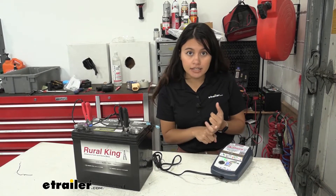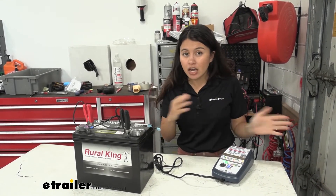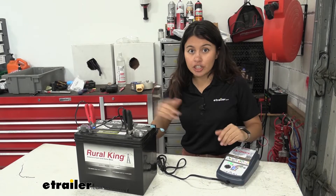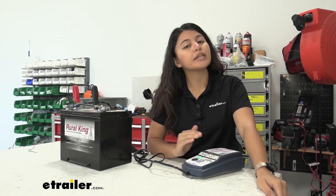During the Save portion there are actually two steps — step four and step five: Turbo Save or Pulse Save. One of the main reasons people get the OptiMate 7 is that feature. Depending on how sulfated, flat, or neglected your battery is, it picks the type of pulse needed to save and charge it back up. Once it charges up it moves to step six — Charge — where the second light turns on if you're at 50% to 75% charge.